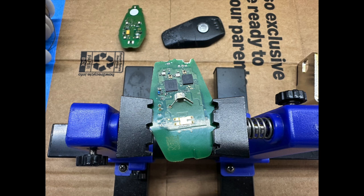I want to preface with a few things about the repair. This is not something that should be necessary. The FAST program — that's Fisker After Sales Service Tool, much like Rivian's RIDE program or Tesla's Toolbox software — would enable us to simply program the new key fob, which the customer supplied to me. We cannot do that. So what we're going to be doing is identifying every tiny component that gives the key fob its identity and hard swap or clone that over to the new key fob, through a process known as micro soldering.